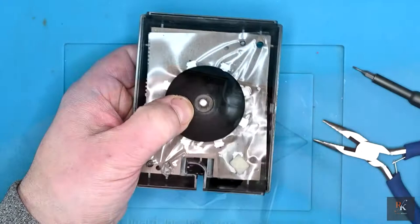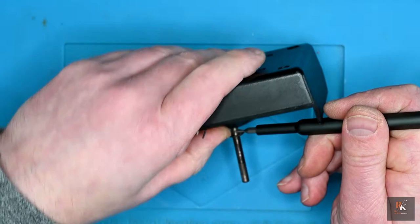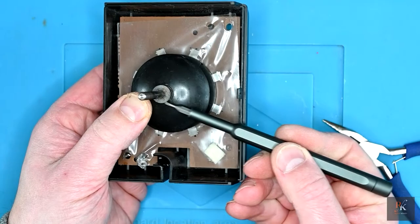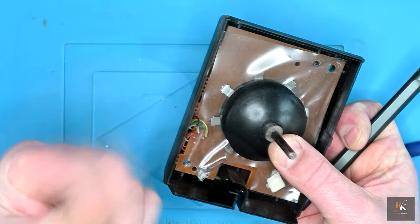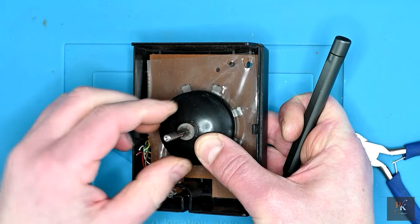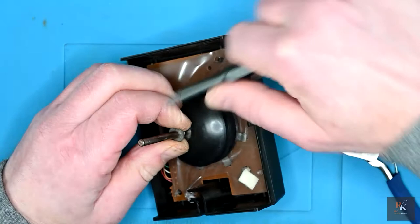Okay, it's lifted, it's past the groove, which is down here. And I did that by going underneath and keeping upward pressure on the clip and just popping each vane in turn. And it clicked and jumped up and clicked and jumped up. Now, I'm not saying it wasn't painful, trust me, it was. It still won't come up of its own accord because the vanes are still trying to grab onto the shaft. So I'm going to have to continue this bit by bit and just click the vanes and get it to jump up a bit at a time.